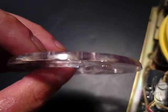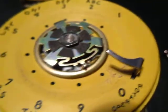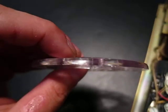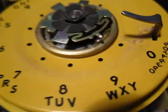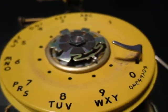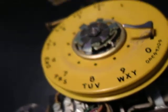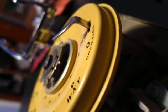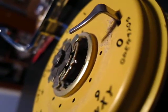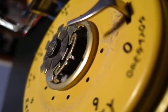Really, when you're sticking a pin or a paper clip or whatever you have inside that hole right here, you're just pressing that tab right there out of that slot. Chances are if you're not able to get it off, there's something wrong and you're not pressing it down right, or in my case it looks to be a little bent. So when I put the paper clip in it did push it down a little bit but not all the way. If you look from the side, even with the plastic dial on, if you look through the finger slots you can get a little bit of a view of that little tab from the side - so you can find something small to poke in from the side and push that tab down just a little bit farther so you can rotate it off.